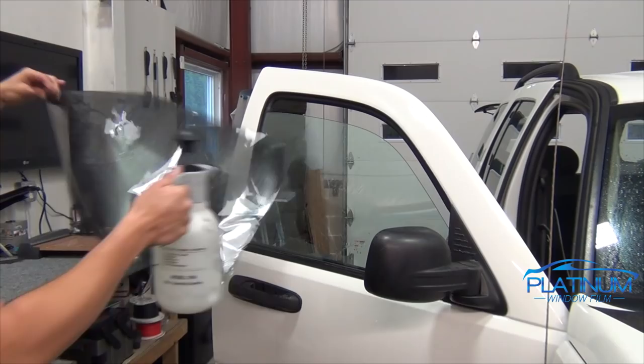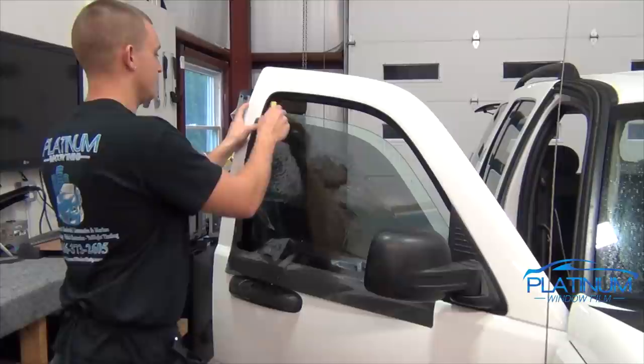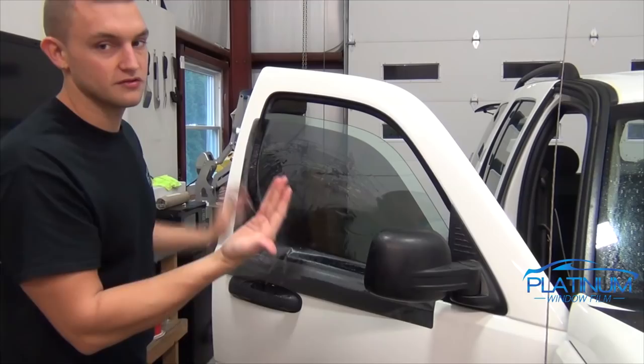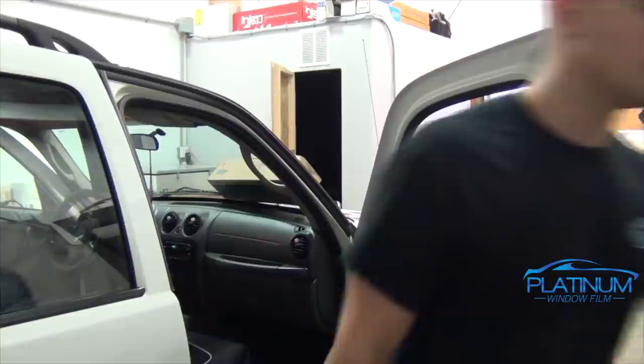We're going to mist up the glass and the window film so that when we lay it on, there's no resistance to sliding around — you want to make sure it's nice and flat. Take your squeegee and squeegee all the dirt off the top, starting from the back going to the front. Before we spray the inside of the glass, wipe the top edge with your fingers — that actually collects a lot of dirt. Assuming you've already razor-bladed the window and wiped it down, the only steps remaining are spraying with soapy water and squeegeeing it out, then applying another layer of soapy water so the film can slide around.